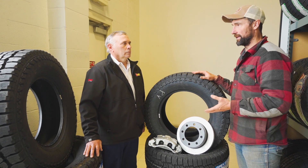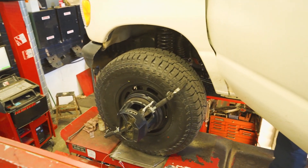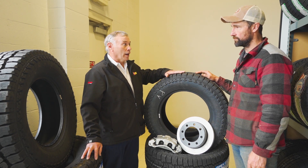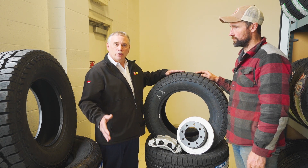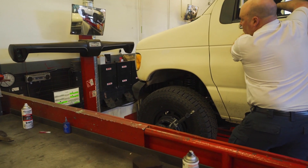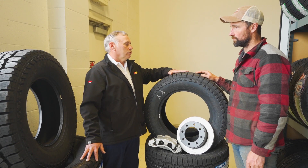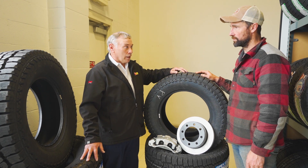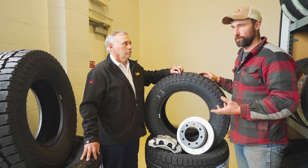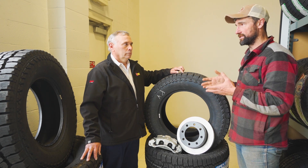One of the things I've always done when getting new tires is have you guys check my alignment to make sure everything is good. Why is that really important for tire life? It's very important — you don't know what's happened since your last alignment. If you get a toe-out situation, you start to get scrub wear on your tires. If your camber changes, you can get inside or outside edge wear, which just shortens the life of that tire. For overlanders especially, suspension and steering components can wear more from off-road use.